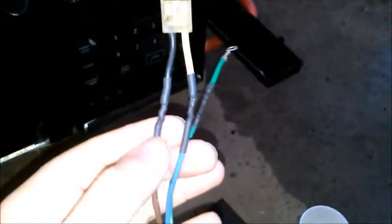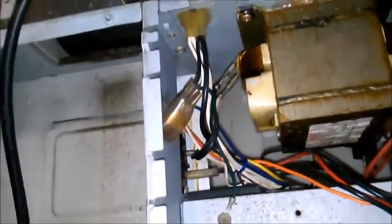It's coming down — the rain is pouring. Anyway, back on this — I fixed the cord: twisted, soldered, heat-shrinked the ground, the neutral, the live. These were originally reversed, and it's going back into the machine. I just came out here to put this cord in. Not gonna run it because it's raining out here now and temperatures dropped as well. So yeah, for now we know it works. Let's rust up the screws.